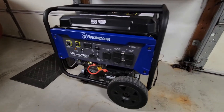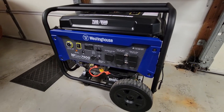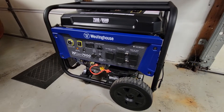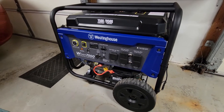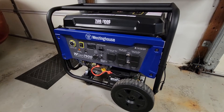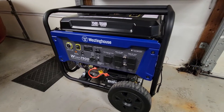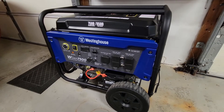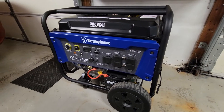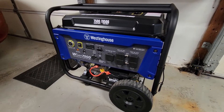As important as having a charged battery is, you also need good fuel, and this can't be overstated. First, you want to keep your tank full. Why? Because air has moisture — if your tank is half full of fuel, it's then half full of air, which has moisture. That's not good for the engine, for the carburetor, for corrosion purposes. So keep your tank full.